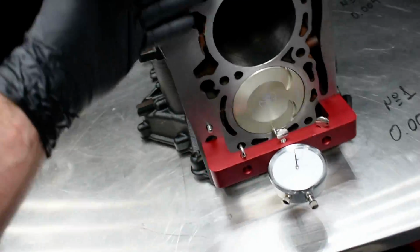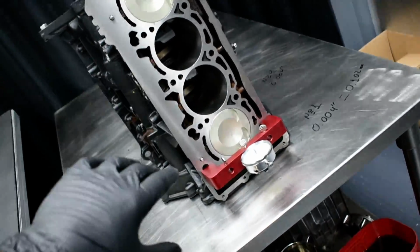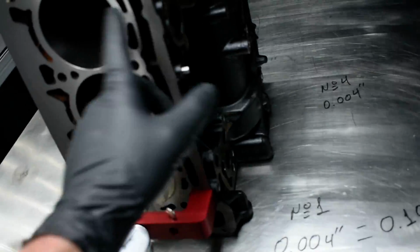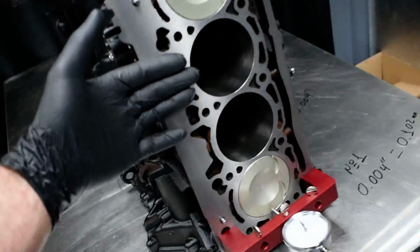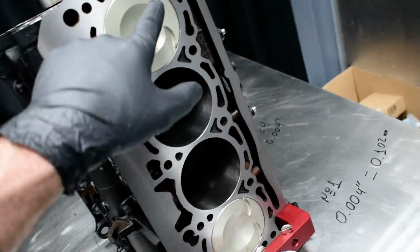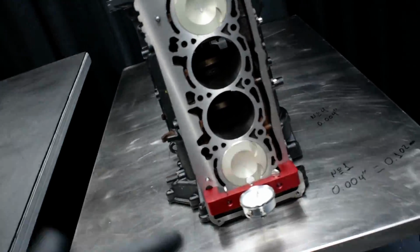This one, because I'm not going to close the cylinder head, I'm fixing the pieces of connectors inside, I'm washing everything, and then I'm sending it to a different place where they're going to put the cylinder head on however they want. So what I'm going to do from my side is mention that the piston on this block is raised up by 0.1 of a millimeter. Just for the information, because if you also resurface the cylinder head and the deck, then you have a different clearance between the valve and the piston. So the one who's going to put the cylinder head on has to double check the clearance just in case. If you use the stock valve train, stock camshafts, valves, and this kind of stuff, he shouldn't have any problem.